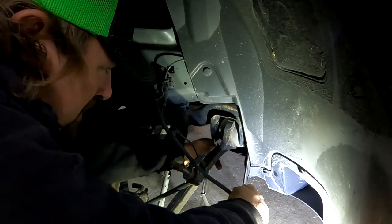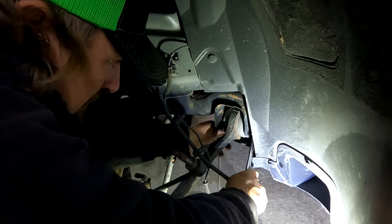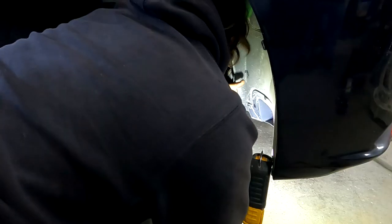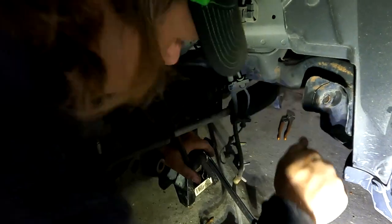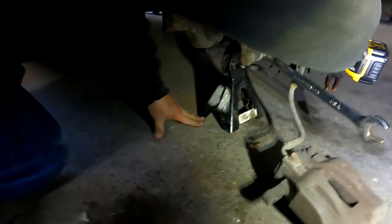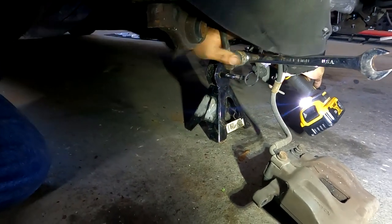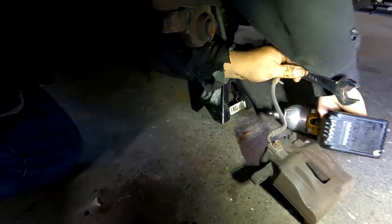Now we're going to remove the bolt out of this radius rod - you can see how bad the bushing is, it's absolutely destroyed. It just has a bolt that goes through that end. You'll probably have to pull the lower cover down to get the bolt out far enough. There's not enough room for a socket on either side - you just have to use a wrench, specifically the open end on the nut. On the other side, the shaft starts spinning - leave your wrench on the nut, grab your impact with a 10mm socket on the shaft, hold the wrench, and spin the shaft right out of the nut.